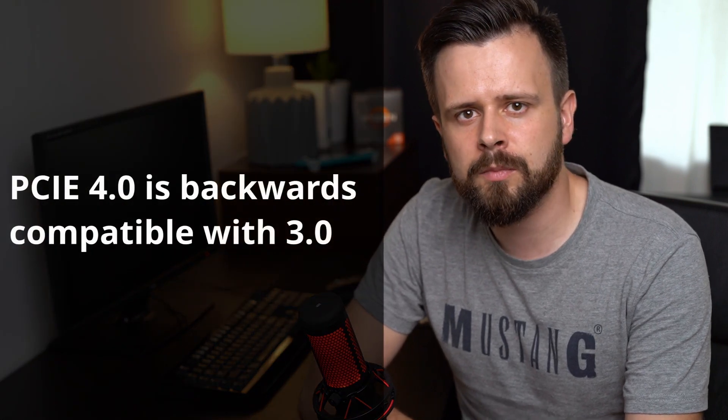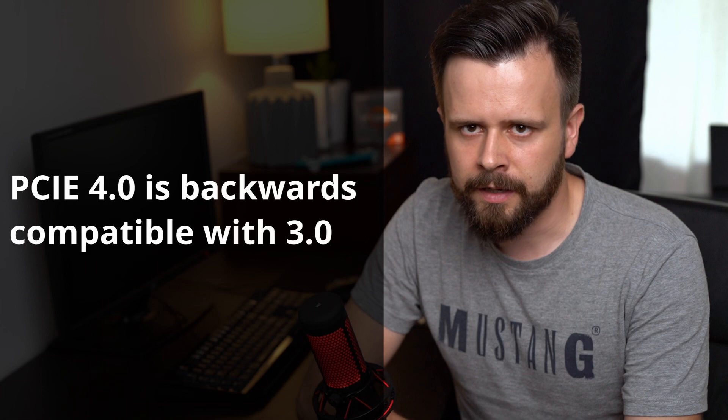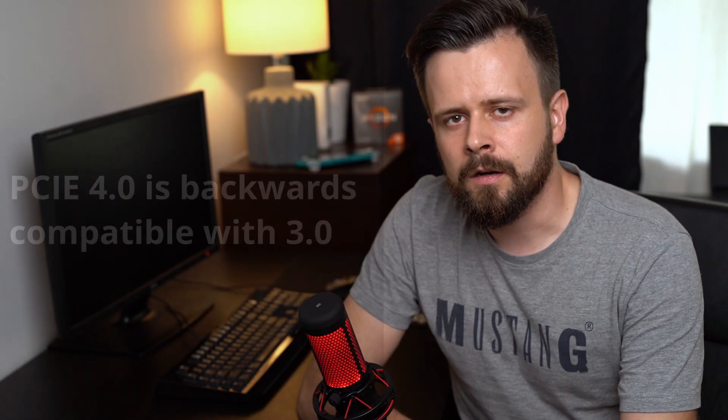Let's sum it up quickly. If you already have a motherboard with PCIe 3.0 running a fairly recent Intel or AMD CPU that can keep up with the RTX 3080, you're fine — you don't have to replace your system or buy a new PCIe 4.0 motherboard, and you should see no performance impact. On the other hand, if your system is very old — like five or six years old — it's probably wise to invest in something more future-proof, and PCIe 4.0 is the way to go. Right now you can only get PCIe 4.0 with AMD CPUs.